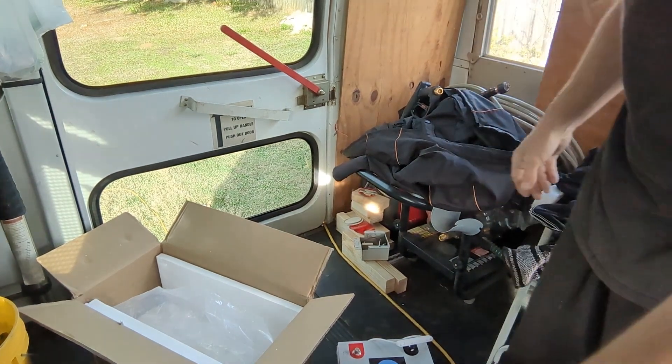I'm gonna attempt to get this on the charger, get it charged up, and then we'll start hooking it up. I'll do a stress test on this battery and see how long it runs the fridge — I'd imagine about a week. I've also got a fuse box for 12 volts; I'm gonna run the dome lights off this battery, and I'll be charging it with a generator while on the road.